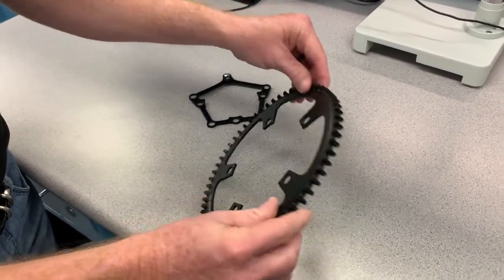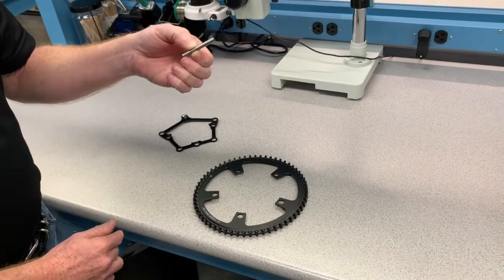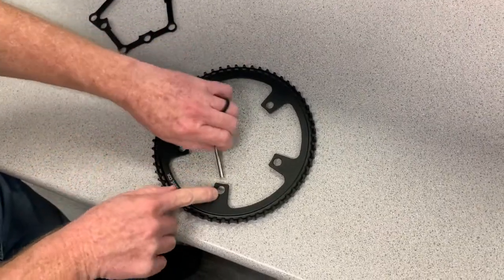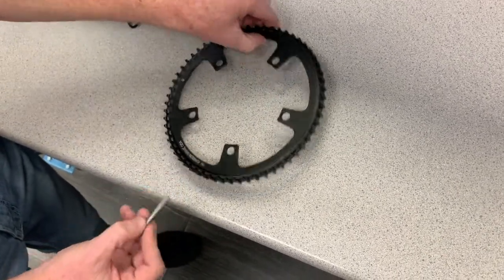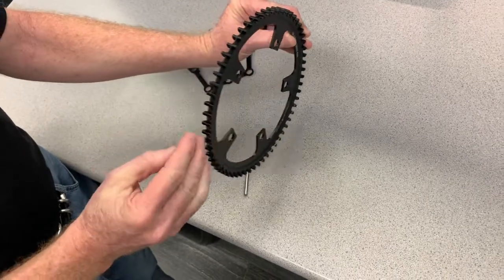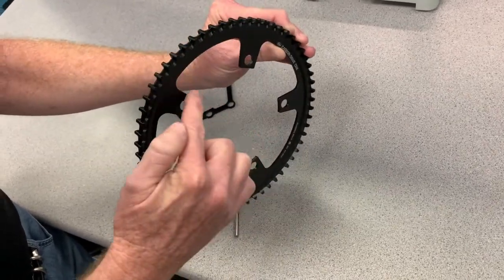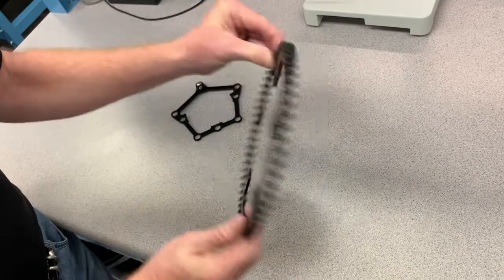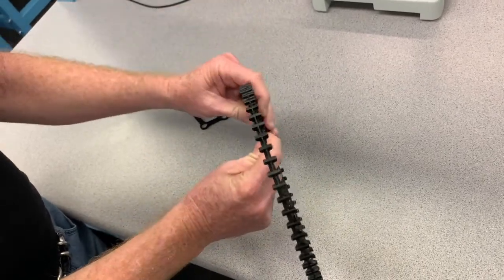I'm going to place this on the table. I've got a 0.22-inch pin and if I check it around here — there's a little bit of imprecision in how this is made — but what I've discovered is that this surface here is aligned with a plane that goes right smack dab through the center of this ring. So this surface which appears to be inset is actually going right through the center, and this surface here is outward.